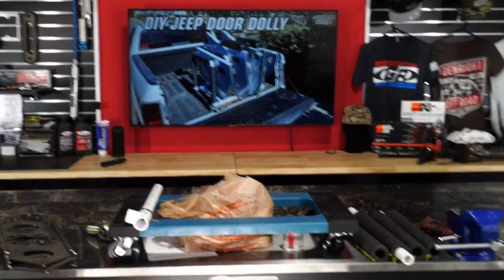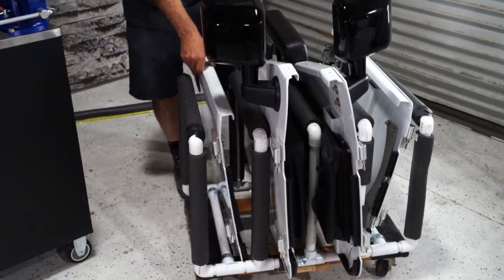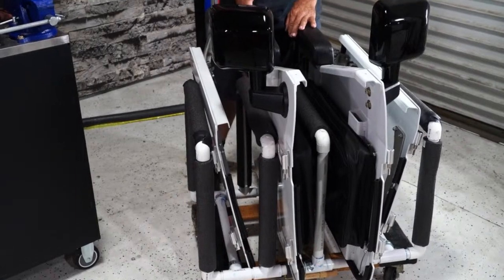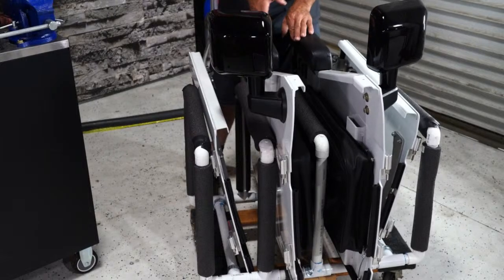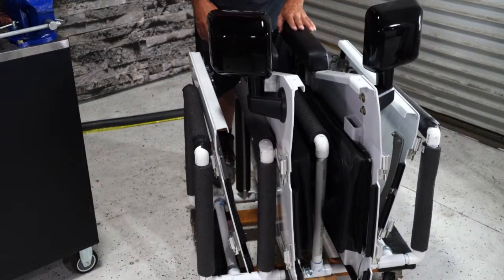James Golden asks: 'How sturdy is that dolly with full doors?' It's pretty good. The bulk of the weight goes down. You can also narrow this up so the doors can't rock. I've got my door bags on here, which makes it about the same width as a factory door with an inner door panel — that's why I chose to make these five inches wide. The doors can move just a little bit, but it's pretty sturdy.